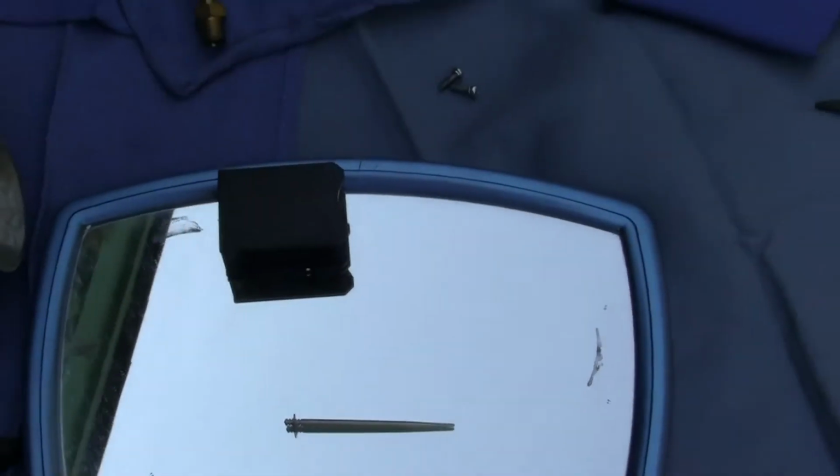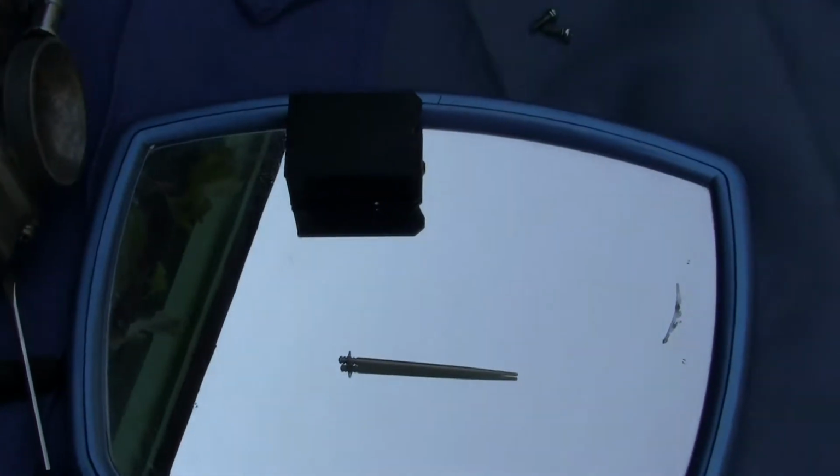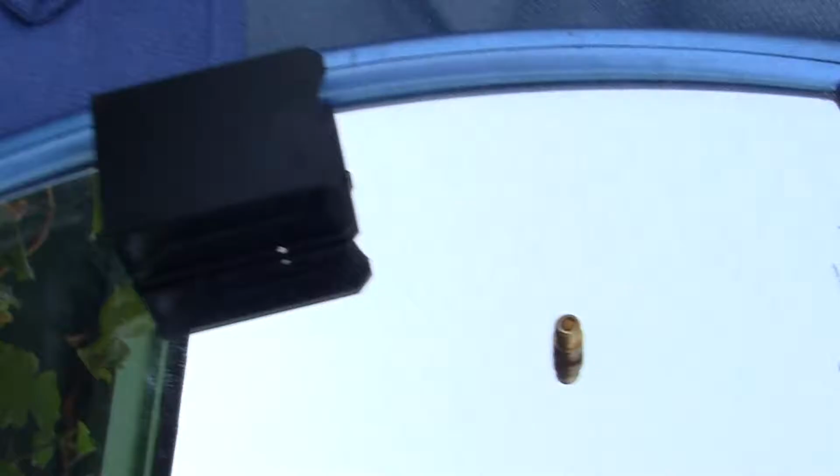So, in order to test my theory, I'm going to take this clip off and move it up so I get more gas from the get-go. If that works better but it still doesn't work, then what I have to do is go in and, where did I put those things at? These are main jets right here. These are main jets that came with the kit. Every jet has a size for the size of the orifice, the hole.